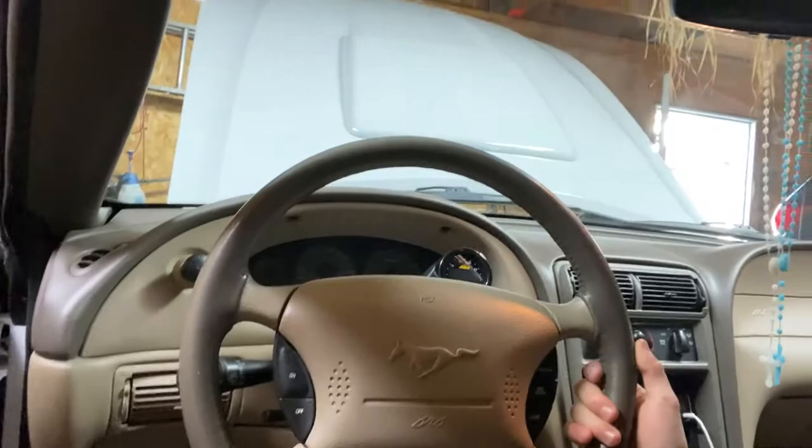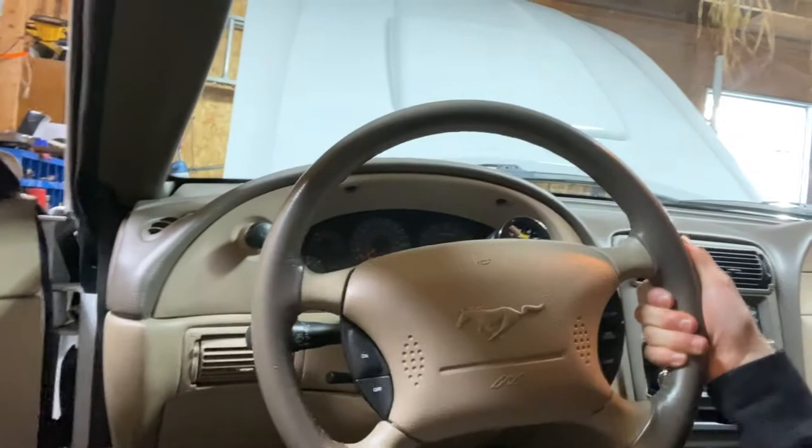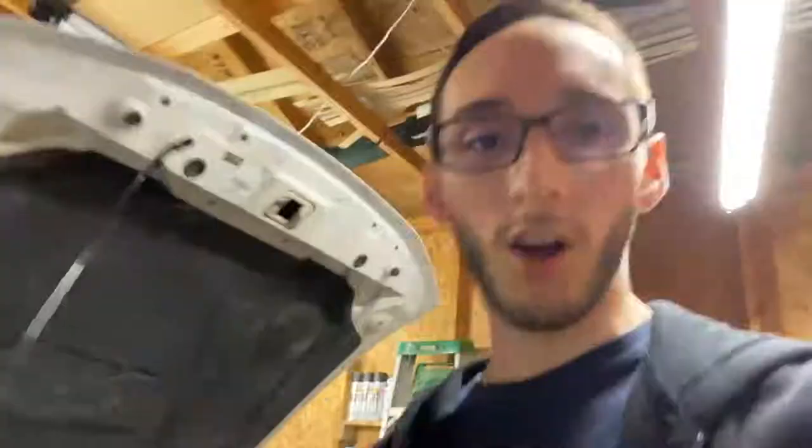Next is to have your steering wheel locked when you go to do the job. This is how it's going to look — it's going to be a little offset just a tiny bit, so there's no way to get this completely straight locked, but just try to get it nice and straight. You heard that click — that thing's not moving anywhere. When you go to put everything back together with the steering shaft it's just going to be so much easier, but even then it can be a hassle, so don't freak out if things don't line up perfectly.